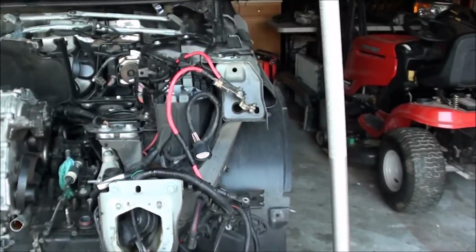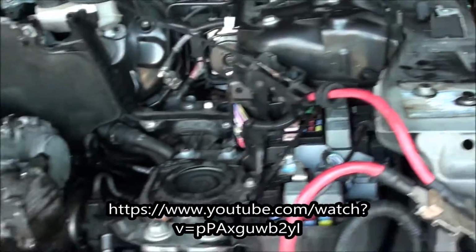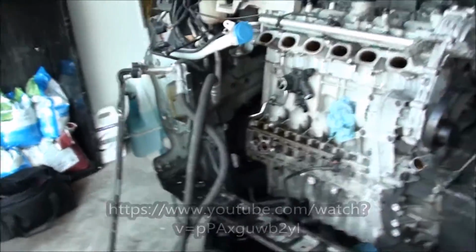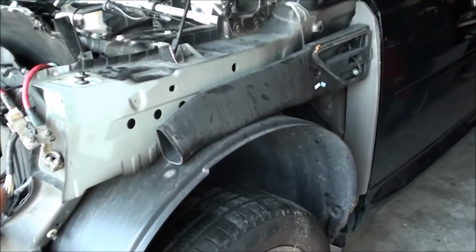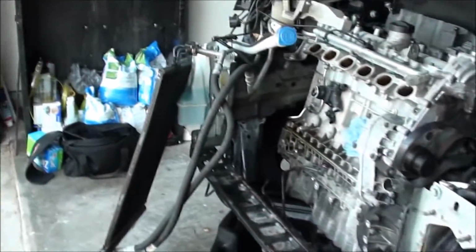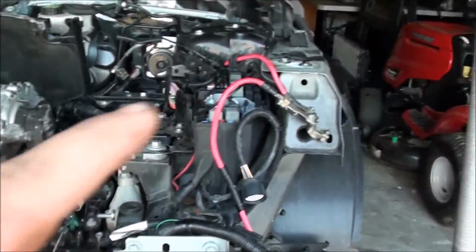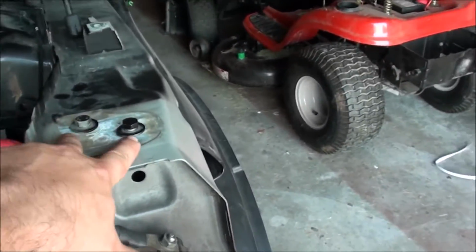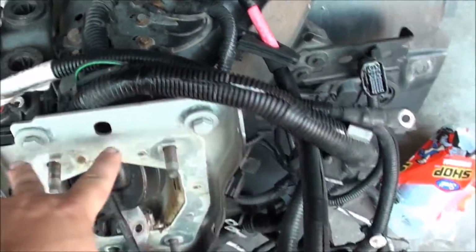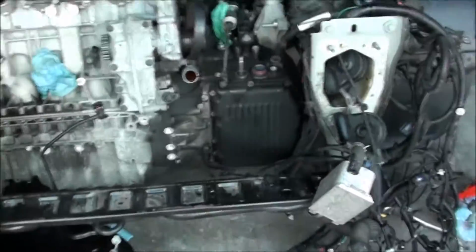I then took off the fenders so that I could get to these bolts right here, which allow me to take off the radiator support frame and really open this thing up. I'll put a link in the description, same video set. He has videos for the fenders and the bumper support, but he did not have a video that I saw for the radiator support. Basically, once you get the fenders off and the bumper off, these 2 bolts right here, same thing on the other side, and pretty much it just comes right off, and then you have this wide open space.